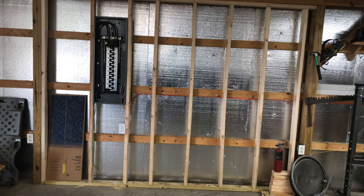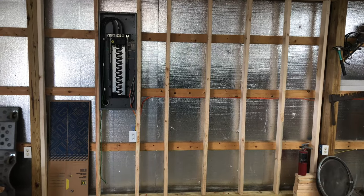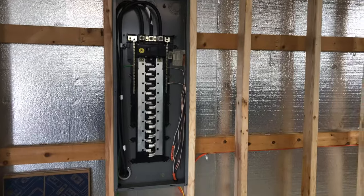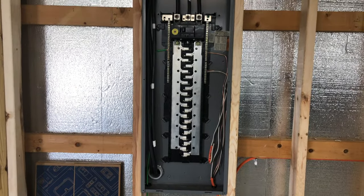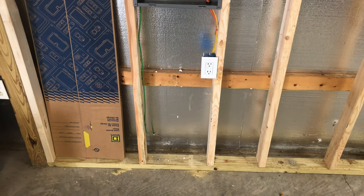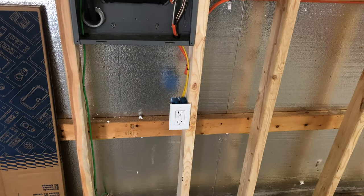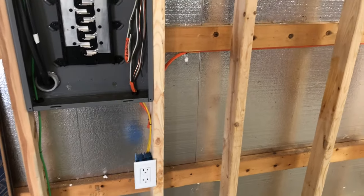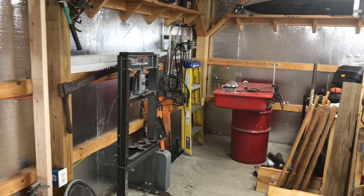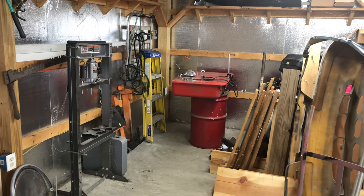Welcome back to Loved Up Garage. In this episode I'm going to run through a couple of updates on the garage itself. You can see the panel is in place now. An electrician was out here yesterday. It's got the panel run, the conduit, and the two main lines in the neutral. The ground is outside, and they've run that cable there. They went ahead and dropped in one outlet so that we have that ready for the inspection, and then the orange cable on the bottom of that stringer runs all the way to the back of the building, out the wall in the corner.